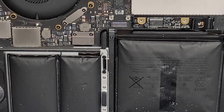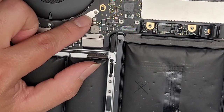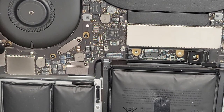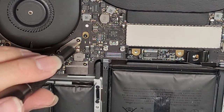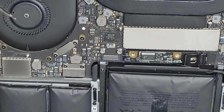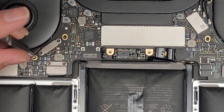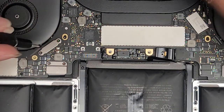This model has no replaceable SSD or anything, but they do have this little port — there's an expensive tool you can use to access the data from it. Most of these screws are T5, except for a few here. I'm going to try removing just the motherboard screws and see if we can lift the motherboard up enough to work on it, but there's a good chance we'll have to disconnect cables too.